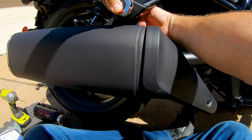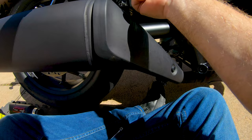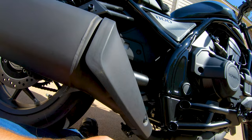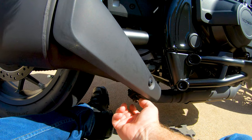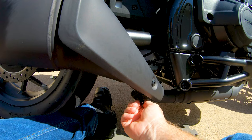Now, this thing has perforated washers, I guess, for weight savings, whatever. I'm gonna leave that there until I get the bottom bolts loosened up. I don't know if you guys are able to see these. I'm trying to move my chest rig down a little bit for you. These are just pinch bolts on this collar. And then on the muffler, there is one of those graphite ring gaskets, those tapered collar gaskets. We're not going to need that for the Coffman's because it's just going to slide down over that header all the way to the shoulder, or mid-pipe. Technically, it's not a header.